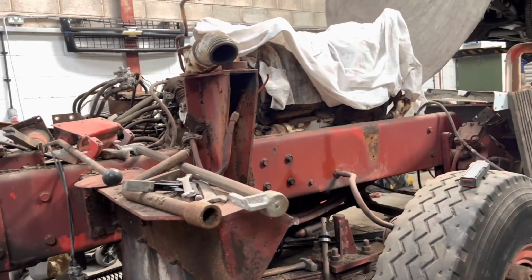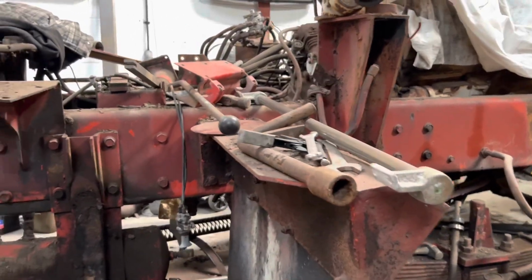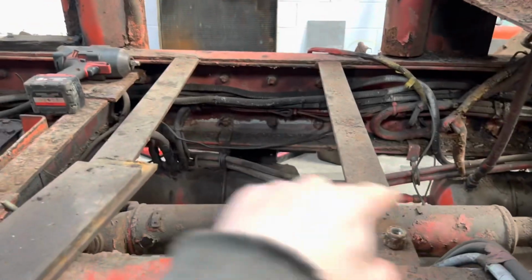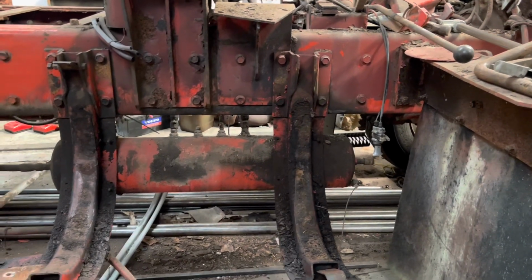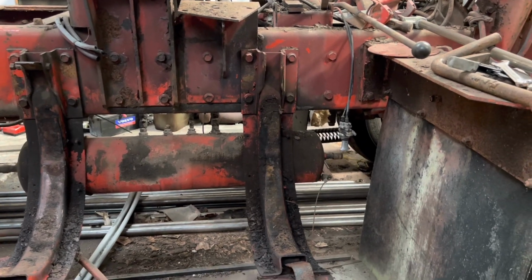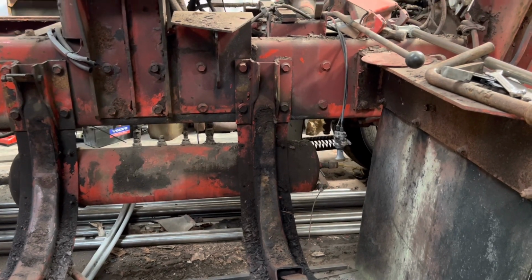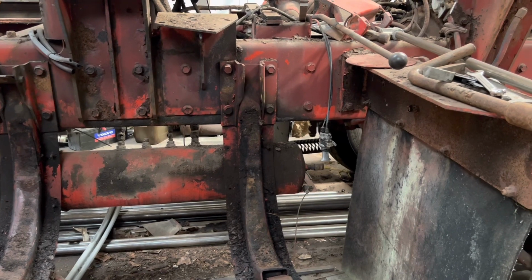B, I'm going to modernise it slightly. Not very much, but just slightly. So, in there, obviously we've got a decent length prop shaft, and there's space for an AP 1750 4-speed Brownie in that area, which means I'll be able to increase the cruising speed to 60 miles an hour quite easily. Right now it's geared to do about 45 to 52, which isn't enough to keep up with modern UK traffic.